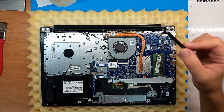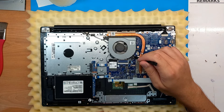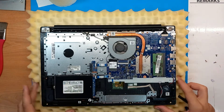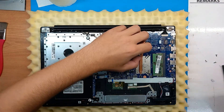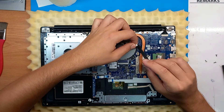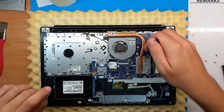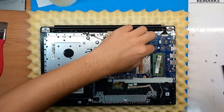The manufacturer also made sure you don't make a mistake — here there's an X and here there's an X, meaning you shouldn't put a screw here from this side. And again, here there are two guides that show you how the CPU fan connector should go back in, matching two little holes from this side.